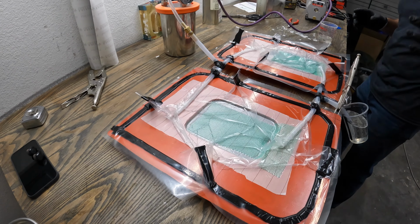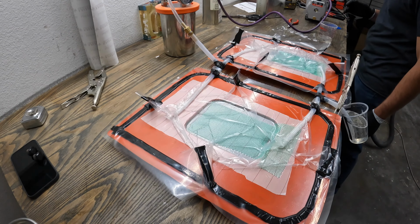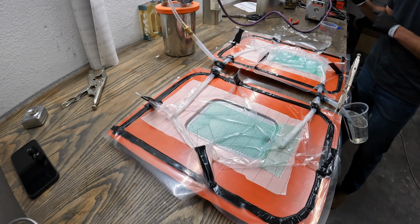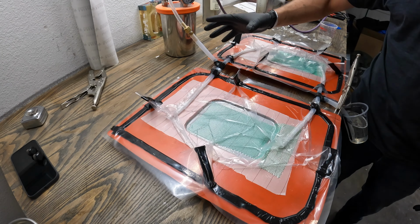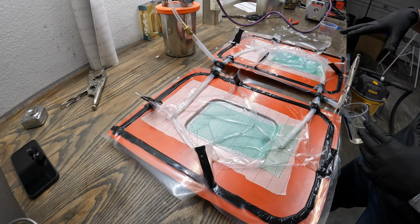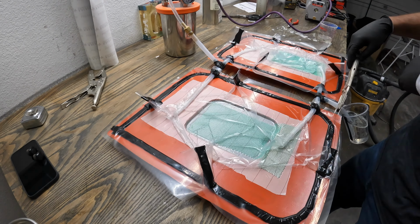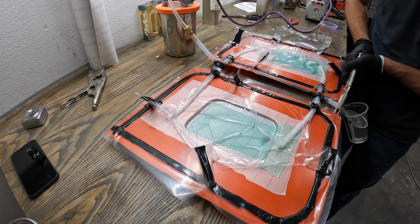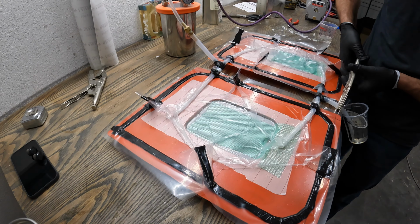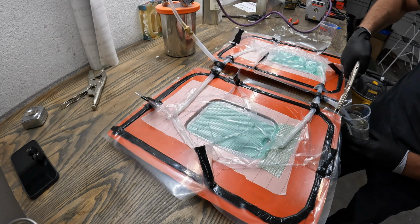As the cup runs, suck some out, I'll put some more in. We'll adjust as needed. Vacuum pump on. Open up this valve. We have a positive vacuum on our parts. Negative vacuum. We have a vacuum on our parts. Active vacuum, I guess. Crack this line. I wish we had better clamps, so I could control the resin flow a little bit better.